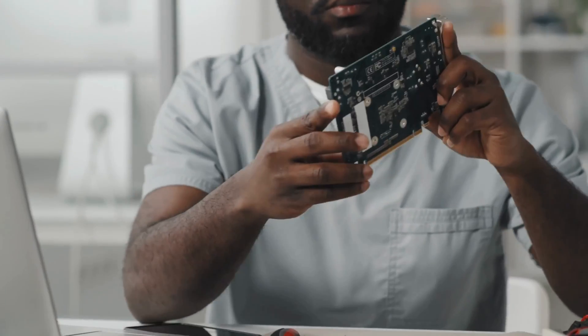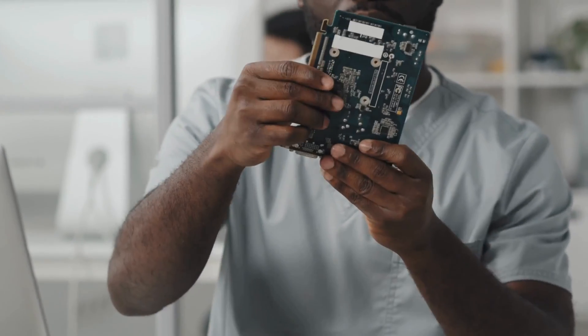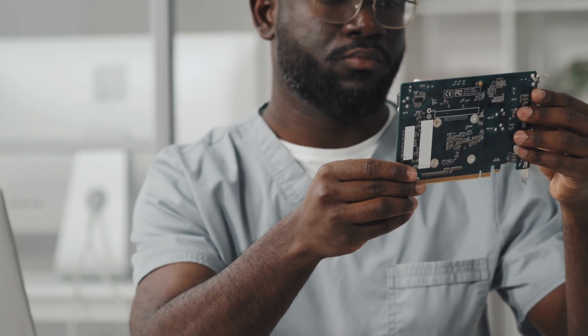Lastly, check the card for physical problems. The final tip is to inspect the card physically. Is the heatsink properly attached? Are any screws or parts missing? Do any components on the card show scorch marks? Do any capacitors look swollen? This is a long shot, but if you see any visible damage, you probably won't have any further luck with that particular card. Replace it, take it to a technician, or return it if it's still under warranty.